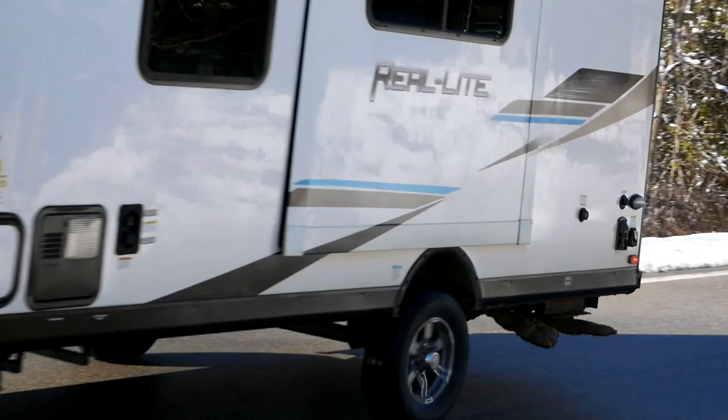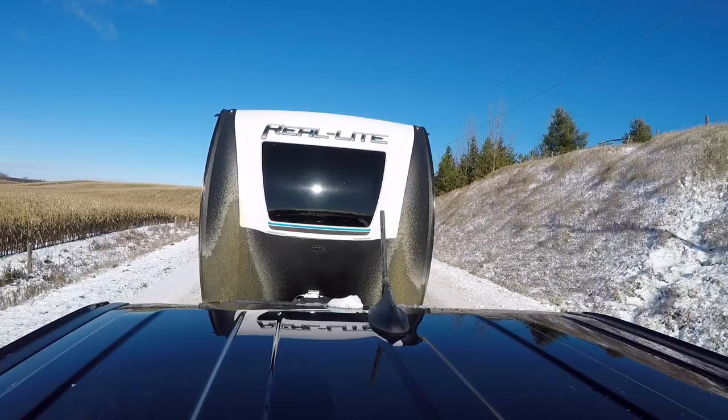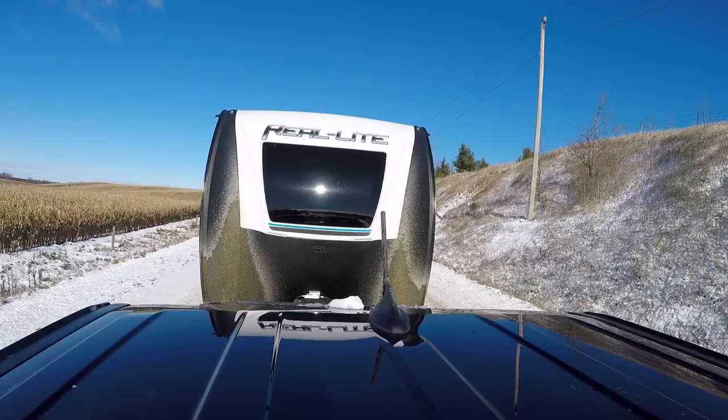It's safe to say we're at the limit of this Maverick — absolutely at the limit in terms of weight. We could have had an EQ hitch too. The question is: does the truck feel like it's at the limit, strained? In typical fashion — not just a Ford thing, everybody does it — they know where the break point is and back it off at least 20 to 25%. So if you do have a 4,000-pound trailer and buy a Maverick, you'll be okay. Tongue weight on this trailer is just over 500 pounds. With 500 back there and 500 up here with us, we still have 200-plus pounds to play with. If you had a full family, you'd be getting close to full payload, but that 1,200-pound number is right there with a lot of other trucks we test.